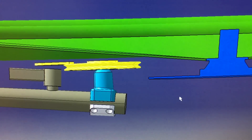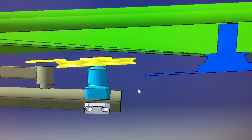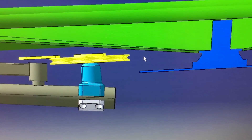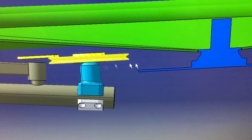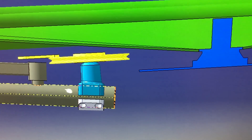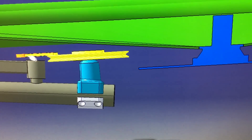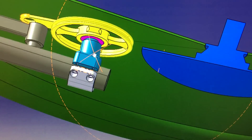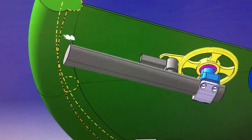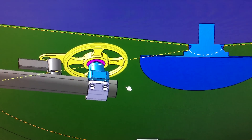The parts shown in this video have been 3D printed on the MakerBot. They were designed to ensure that the pulley will line up with the hub, that the axis of rotation will be parallel to the wheel's, and that the angle with the frame is correct. We also need to make sure the magnet will come just next to the sensor without touching it.